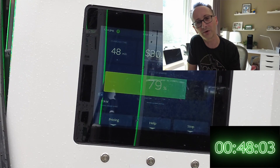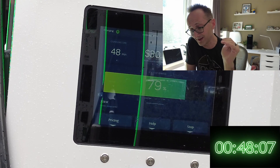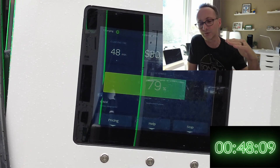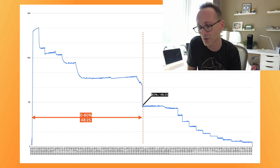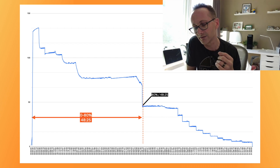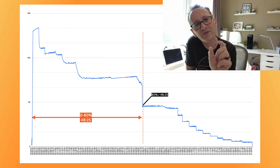Going a little lower, after the 93 kilowatts, it goes down to a plateau of 75 kilowatts that the car draws until about 46 minutes, and that's when you're at 76.5%. After that, about that last 4%, it starts ramping down to its 80% plateau.